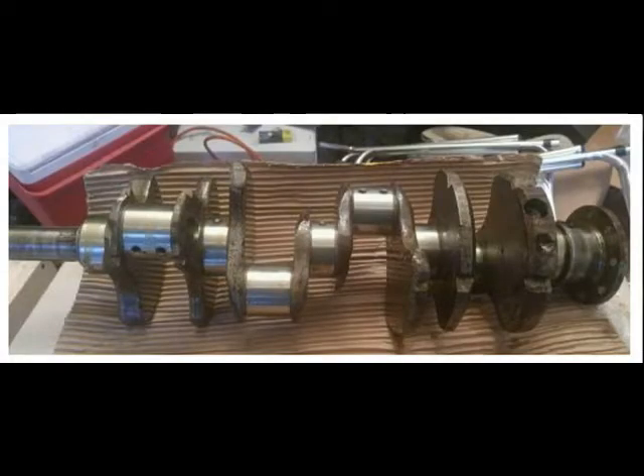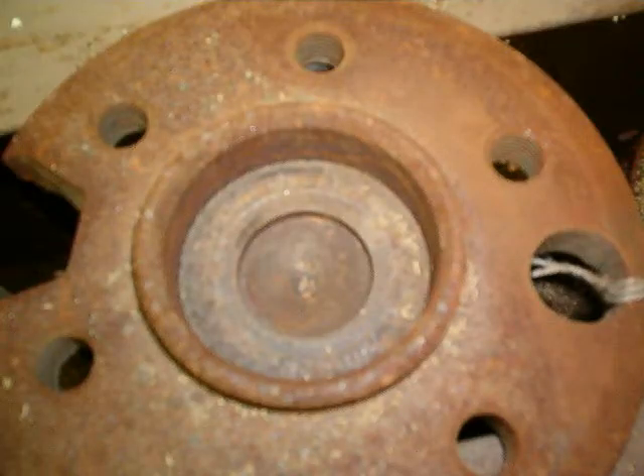There's really not a lot that needs to be said about the Gen 1 Hemi crankshafts. All the Hemis had good forged steel cranks. For some reason, however, even clear into the 1970s, Chrysler generally only drilled the back of the crankshaft for a pilot bearing if the engine was getting a manual transmission. Some were not drilled at all, others only partially drilled.